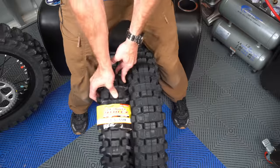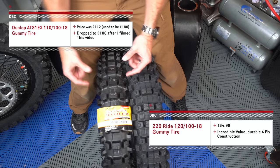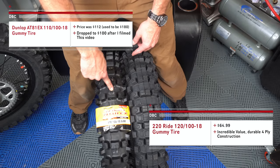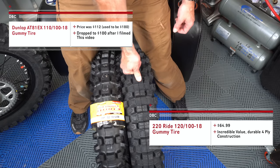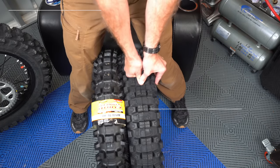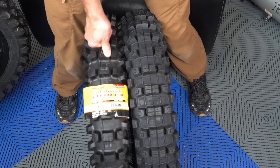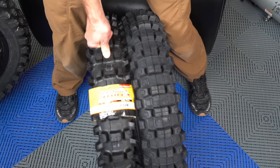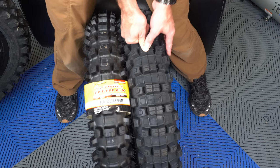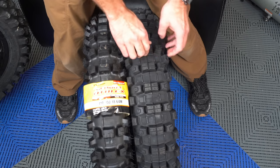Let me show you what I'm talking about. Look how easy it is — I can just barely push down on this thing and really get the crown to flex on this Dunlop tire. Now that's good in some ways, but it's bad for flat resistance. Look at this: I push the 220 Ride tire and I have to use both hands to get that crown to flex in the same way that I can do with one finger on the Dunlop. I cannot make it flex easily because there's so much more material in the crown of the 220 Ride tire.